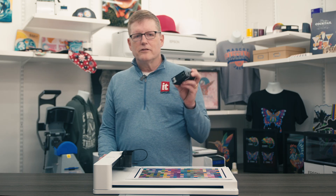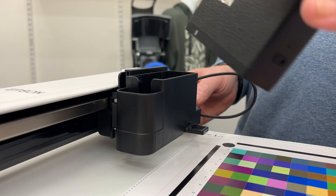Here's how it works. Simply download the Epson Edge Color program from Epson's website. When prompted, go ahead and license your new color table using Epson Port. Next, calibrate the SD10 and then attach it to the Auto Chart Reader. To create profiles or calibrations, go to Epson Edge Print and select Epson Edge Color in the upper right of your screen. When prompted for the device, scroll down to select the SD10 Series option. After that, follow the prompts to print your target and measure it in.